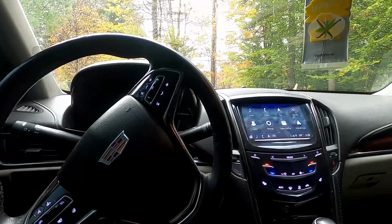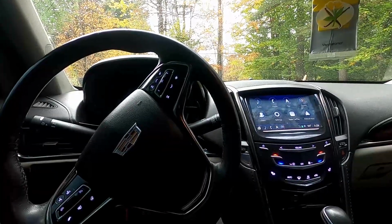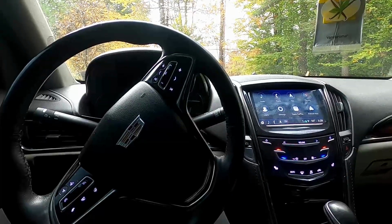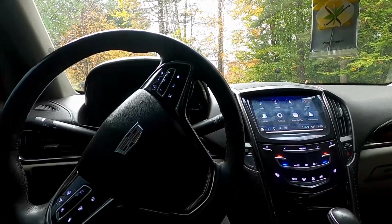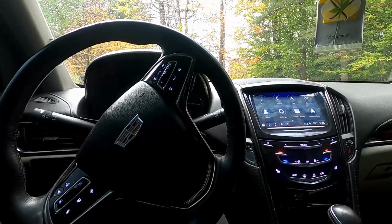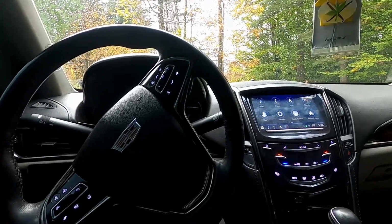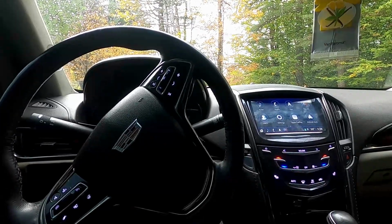I'll put that information up on the screen. Also, for disabling the ANC, which is ambient noise control. That's what it stood for, ANC. So there's an ANC system, ambient noise control. It does something weird with frequencies, and it plays pitches through your speakers. When you hook up an aftermarket sub, it starts playing all these frequencies through your sub, they get amplified and your sub just starts ripping really loud, and that was really annoying. So that's fixed, and I'm just gonna put the car back together, but that's all you need to do to hook the sub up in this Cadillac.